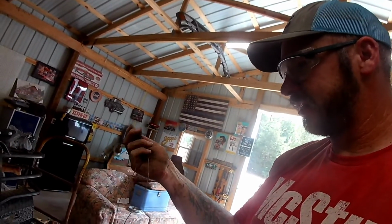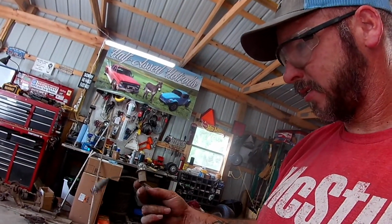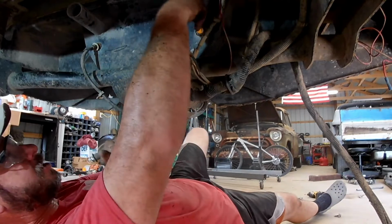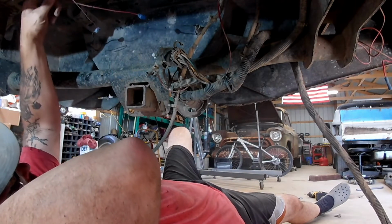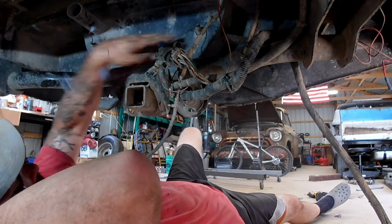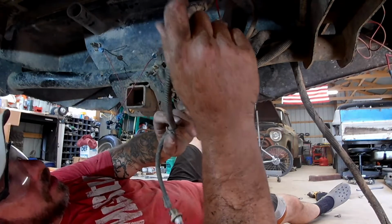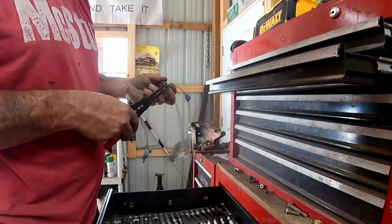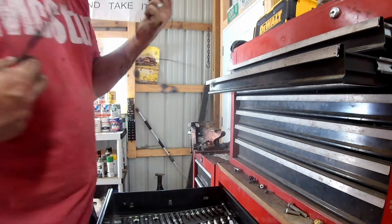So these lights fit this bumper, but they've got the guillotine connectors, so I'm not going to reuse those. I hope these lights work. And they ground through the bumper, it looks like. Because there's only one wire, so they must ground to the bumper. So these guys just shove into the bumper. That's how they work. But we're going to cut all this crappy wiring off here. And then connect it to the factory lights. Right here. Start by cutting these off. Throwing all this in the trash.